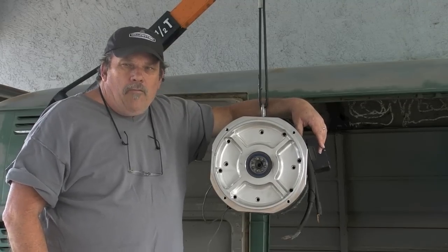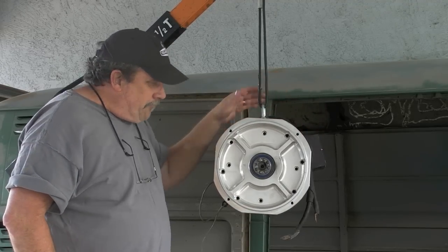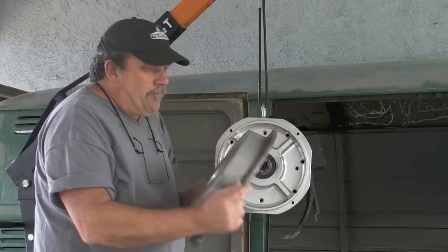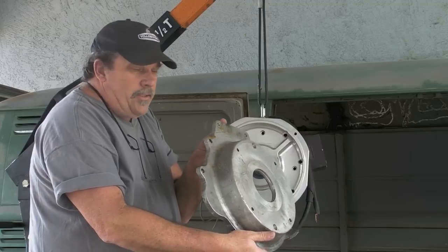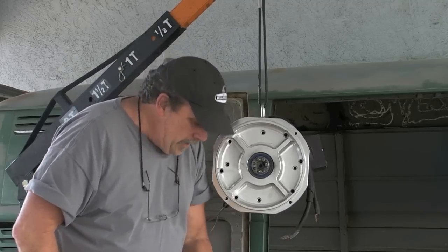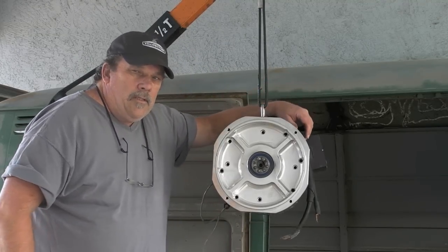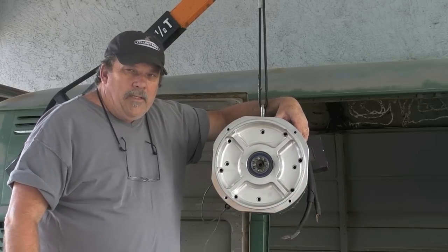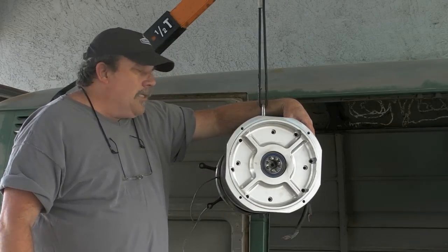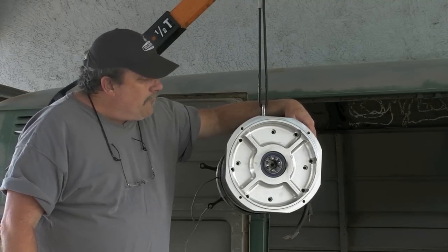I didn't find any that were overly suitable for me quality-wise — just came up with the old standby cast style adapter plates, which bound all over the place. They do the job but require a taper-lock bushing, which I don't particularly like. I searched quite a bit because I found an adapter plate from an old setup, very well built, and was trying to find something comparable that would fit the larger motors instead of the little dinky starter-generator type motors from the late 70s for the early Volkswagens.